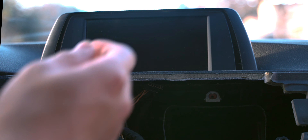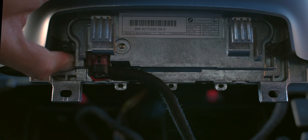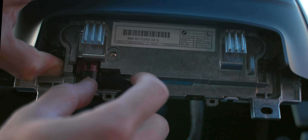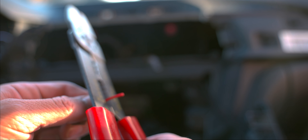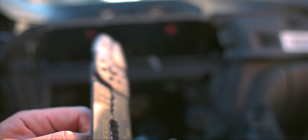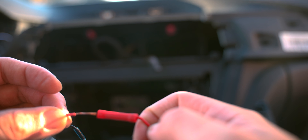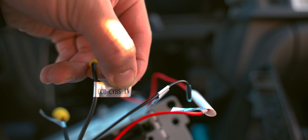All that you do is pop off the old wiring harness and you're good to go. There's nothing connected or holding on to our screen, so all we have to do is lift up. To disconnect the screen, turn it around — push in on the connection, wiggle it side to side until it comes out. Now we can remove the old wiring harness. Because this is an aftermarket camera, we are going to have to splice our 12-volt wire from the Koason screen. And when you're using your video in from the Koason wiring harness, make sure it's the CVBS in, because the camera signal will go into the head unit and then up into the screen.